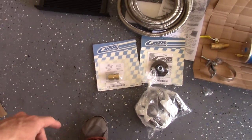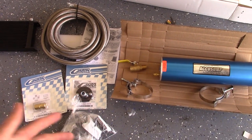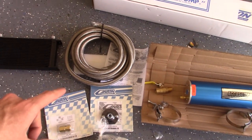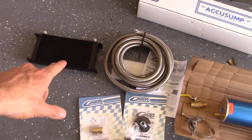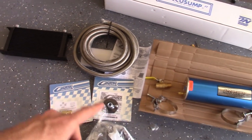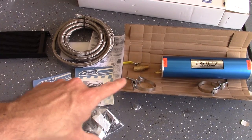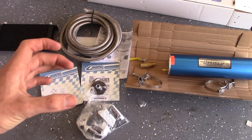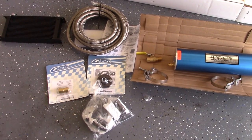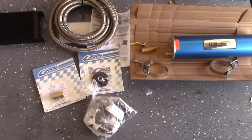There's a little check valve, but we're going to run a manually operated valve because it's just easier — you don't have to mess with the wiring, it'll just be simple. We're going to run an oil cooler, doing a new setup. We're going to basically tap all this in. We're going to run a line through there, we have a little sandwich adapter, and we're going to plug all that stuff up and route it. I'll show you where we're going.